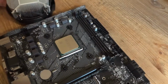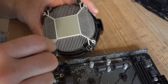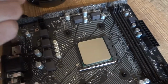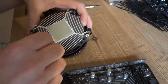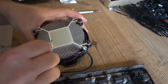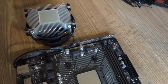Now, the thermal paste, that's a lot of it. They really put a lot of it. You really need like a pea-size drop or maybe less. So, if you ever gonna remove that cooler once it's installed, you'll see that thermal paste is gonna be spread all over the processor, like all over the side of it, and it's just nasty. So what I'm doing is removing the excess on the sides, and it's not gonna hurt anything because whatever's in the middle gonna spread out to the sides, and still it's probably gonna be too much, but it's gonna look better either way. Now I removed that.